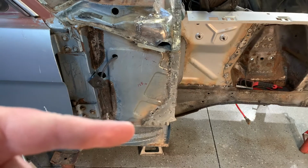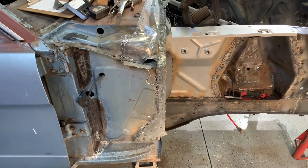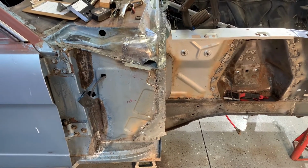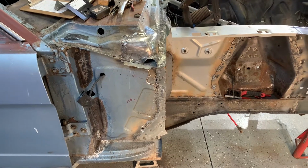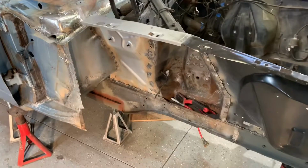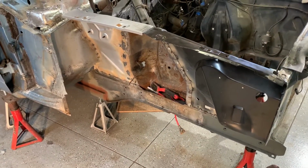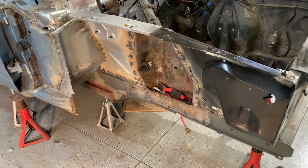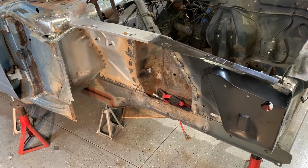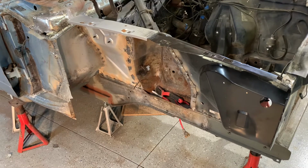It's almost fully welded, but getting a lot of gaps in that. That welder, the little Harbor Freight I got, flux core, settings are low and high, so low is not low enough. But the Dynacorn panel fit in real nice. Had to tweak it just a little bit. It's probably one of the best body panels I've put on so far. So next time I buy body panels, I'm gonna try to get Dynacorn and pay a little bit more money for it. I think it's worth it in the long run.